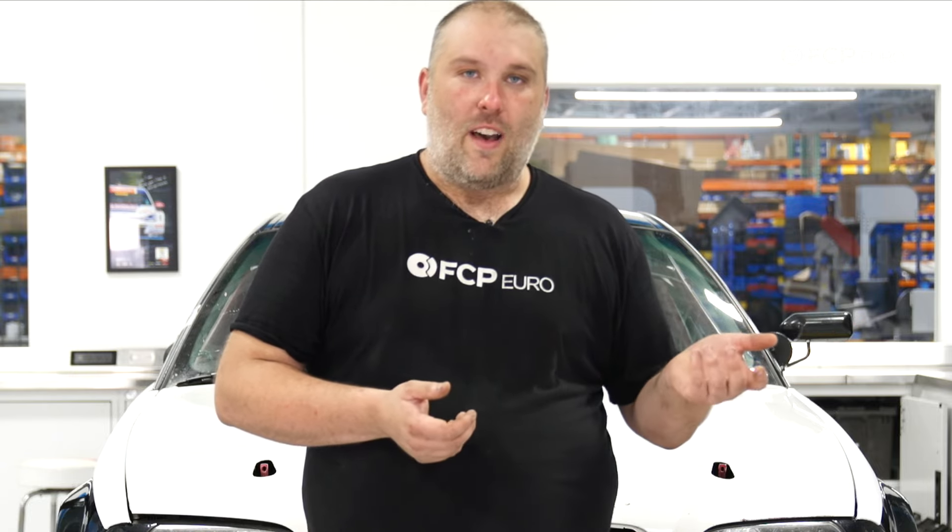All in all, it's obviously a huge job — a clutch job is never going to be easy. You do need some specialty tools. If you're working on the ground on jack stands, this is more difficult than on a lift, even with a transmission hoist and pole jacks. We were working on a race car, so a couple of things were different — like the engine mounts — but the process carries over to many other BMWs: E36, E85, E86 — really any straight-six BMW in terms of how the transmission is installed. We used different flywheel bolts because of the torque plate, going with E-Torx M12 by 1.5 by 35mm bolts, and they worked out perfectly.